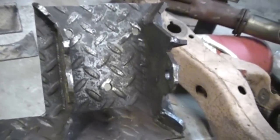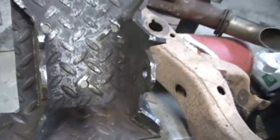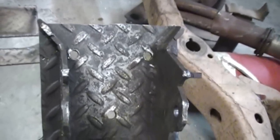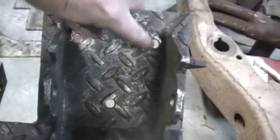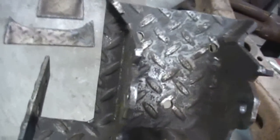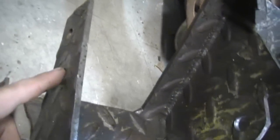For the newbies, the reason you want to run an engine cradle on a small block Chevy is how they normally mount. Basically these three bolt holes here — the bosses will break right off the block when the motor shifts forward and back. The cure is to build something like this that also bolts on the original mounts. On early '55 to '57 Chevys the motor mounts actually attach up here; GM, when they changed the blocks, never did away with them so they're still there.